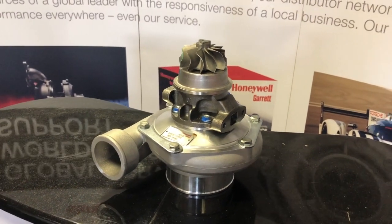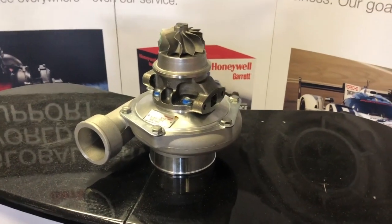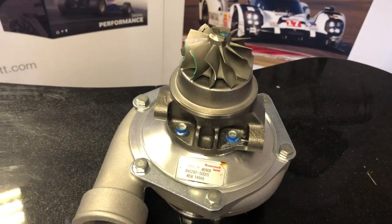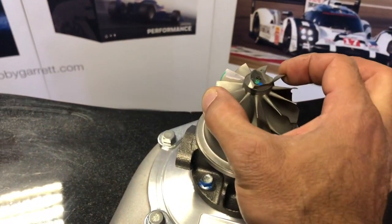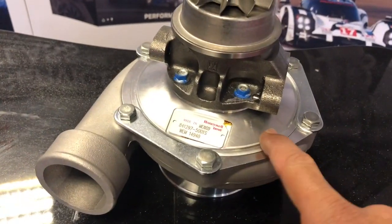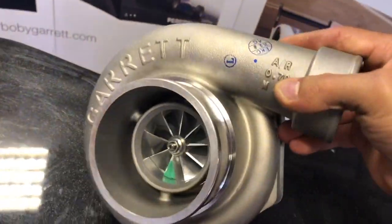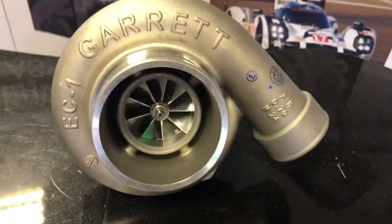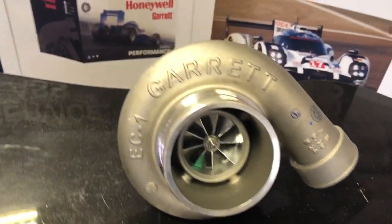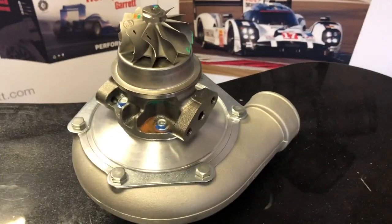Next up is the GTW 3476, at 700 horsepower capable. It is based on the old Garrett T3/T4 family combination — a T3 Stage 3 turbine, 55mm in front and 65mm at the back. It features a journal bearing housing with aluminium back plates, AR70 compressor housing from the T4/TO4E family, and runs the GTX-derived bullet compressor with a high-flow nine-blade design inside. It is fully serviceable with all components available at a fraction of the cost of any other performance turbo on the market.